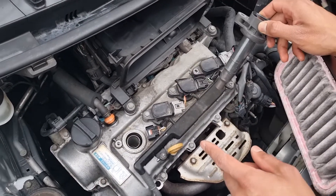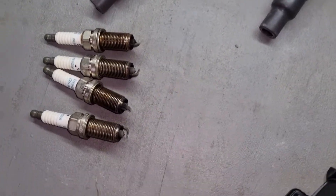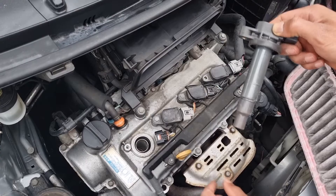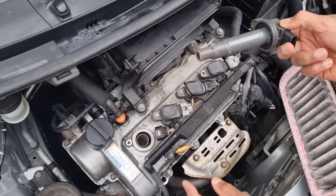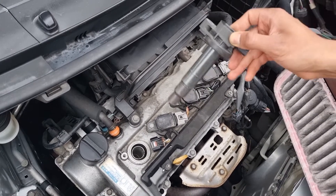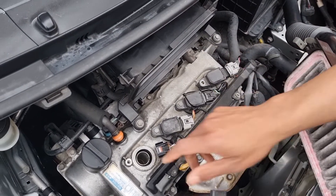As you saw, number one has failed. Sometimes when these coils fail it's due to the plugs as well, because the rule of thumb is you change all your plugs at every interval specified by Toyota. Most people don't bother, and this is the result — coils play up because they have to jump the spark further when the plug gap gets wider. It's harder for the coils to produce the power for that spark to jump. So we're going to replace all the plugs and replace this one coil. Keep watching the other coils — if a misfire comes up later, it's a result of the worn plugs.